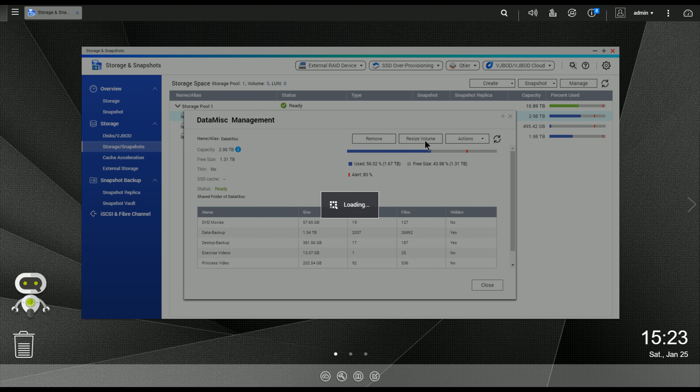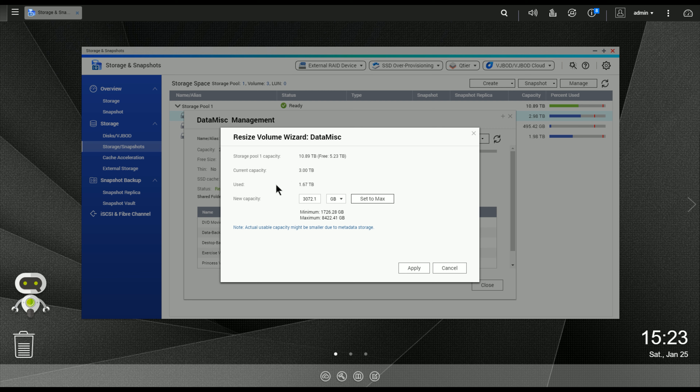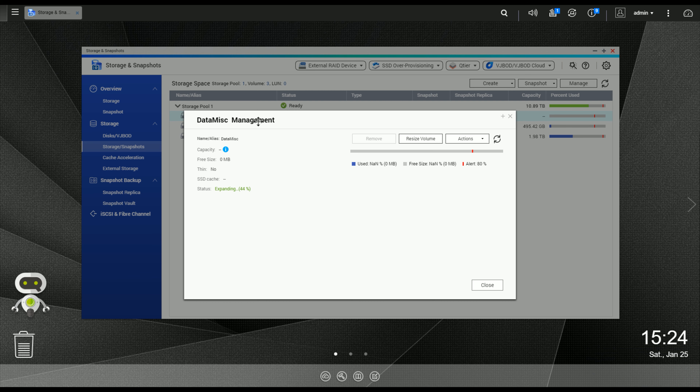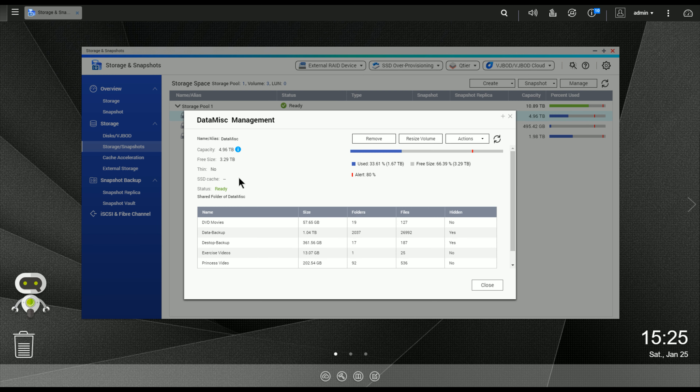Once you understand that, click OK. It's now preparing to start the expansion, and this is going to take quite a while. Depending on what you have your priority set to, this could take even as long as a couple of days to rebuild your array, depending on drive size, drive speed, and the size of the array. Looking at the background tasks, it's telling us it'll take about 31 hours, probably dropping to around 25 hours — so somewhere between 20 and 25 hours before it's actually completed. Do not play around with your storage pools or volumes until the expansion is done.